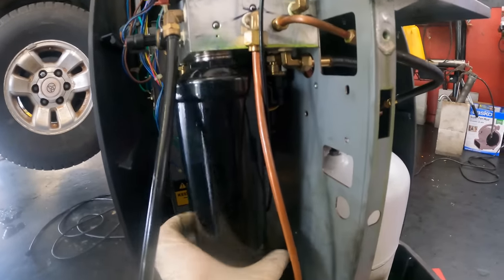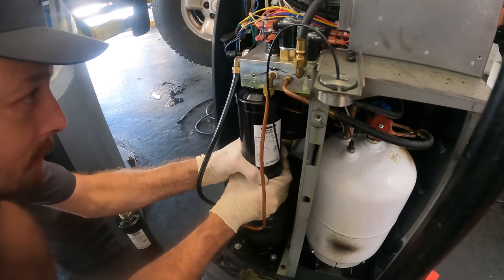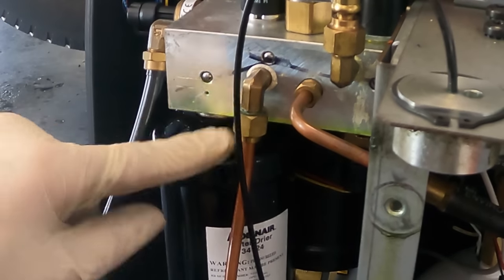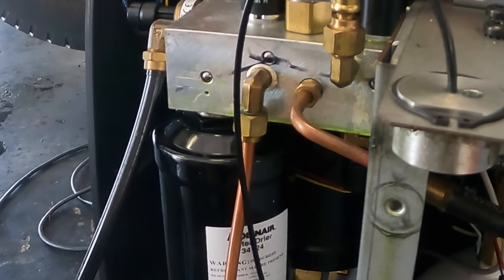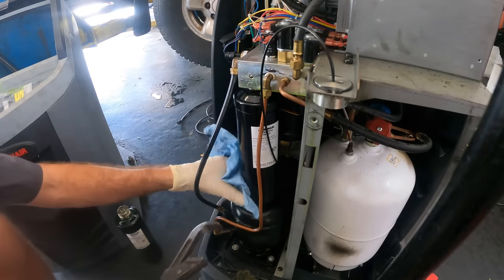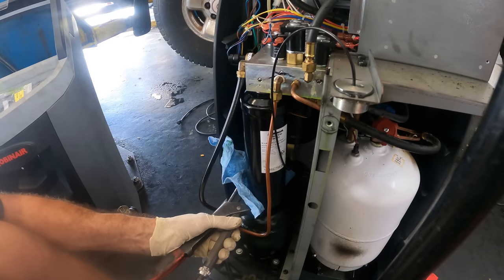I do want to give this a little bit more torque. There's a special low-profile wrench I'm assuming that fits in there — I don't have one that size. So I'm going to revert back to the angry pliers. I call them angry because they're very aggressive — I don't want to smash this filter, so I'm going to use this towel and grip it from the weld at the bottom so it doesn't collapse on itself, just give it a little oomph to secure it tighter.